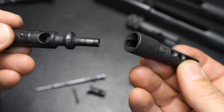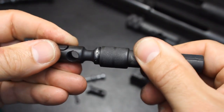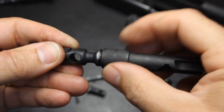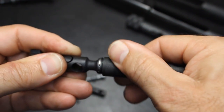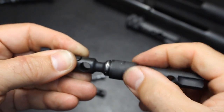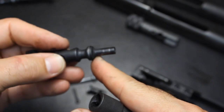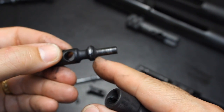We're going to take the end of the tool here and place it right over the neck of the bolt, right here, and just start to turn. Now I apply some pressure to make sure that I get it, because this tool is really made to fit as many possible combinations, and because of different manufacturers there are different sizes. And what this will do is remove all this carbon that's built up right here.